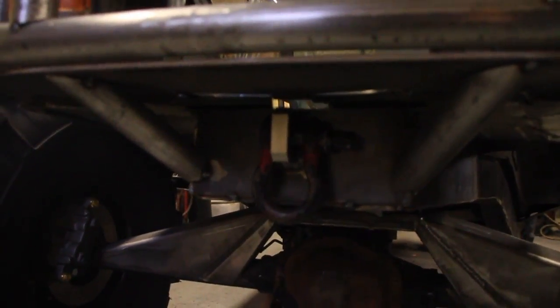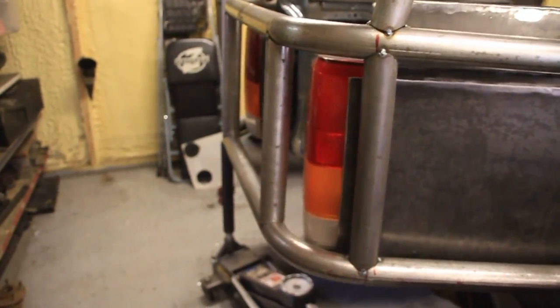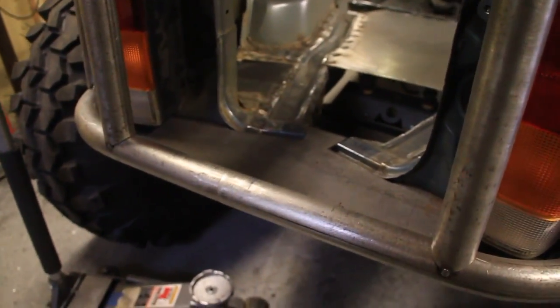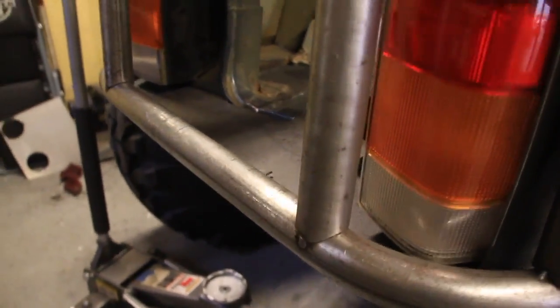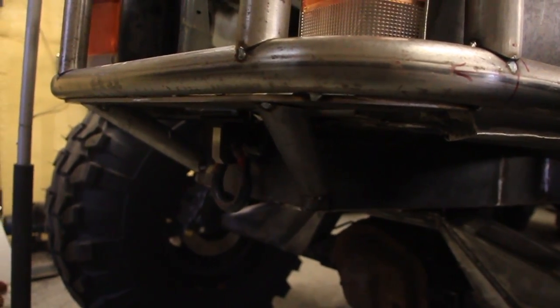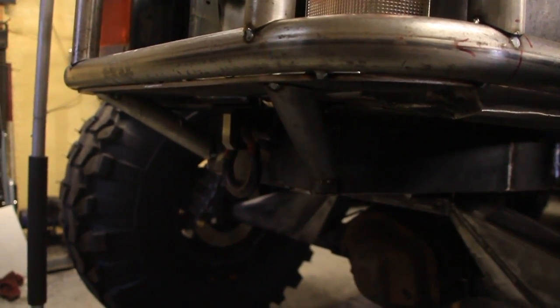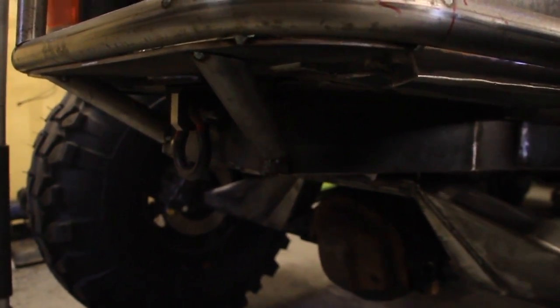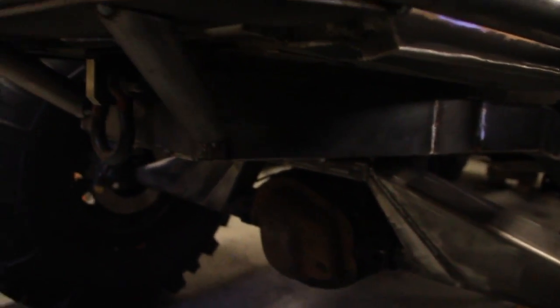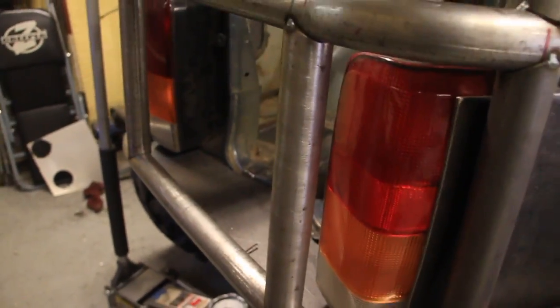Under the bottom here I've plated it. I've got a shackle down there so I can pull somebody or get pulled backwards if I need to. I put a quarter-inch plate — instead of making a bumper like I did for the front, I just put a quarter-inch plate welded to the bottom of this tube. I'm not going to weld it fully so I'll be able to wash it out, with little wash holes where water can still come through. I made these bars at an angle so that if I hit something going backwards, it'll just ramp up it instead of stopping.